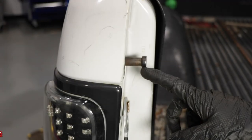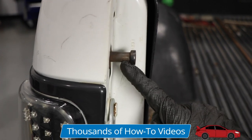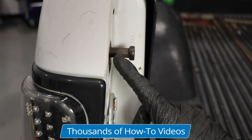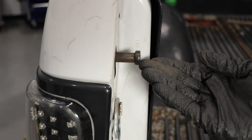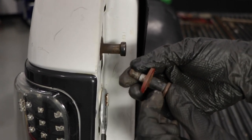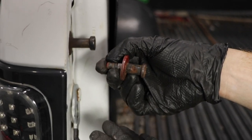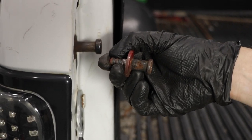Check both sides. Looking right up here is where your striker is — that's the area where the latch is going to go. You can tell right where the latch usually hits up against. If it looks like it's worn in or has a dimple of some sort, that could potentially cause an issue. Some strikers are going to have a nice rubber coating around the outside, but if you turn it around you might see that the coating's missing. If it's supposed to have the rubber coating and it doesn't, you're also going to have an issue.